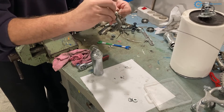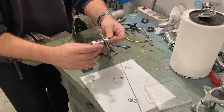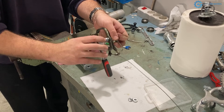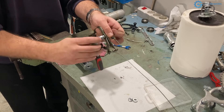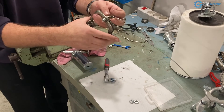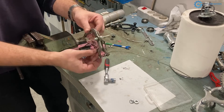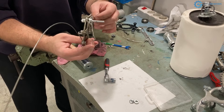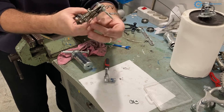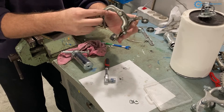On the other side, because the spring-holding section is fixed onto this nut and screw, I don't have to use any lock nuts on that side. Otherwise I would first put lock nuts on the other side, roughly estimate how much protrusion I need on the front, lock it up on the back, and then do fine adjustment on the front. Here I'm making sure only to use the socket wrench to screw in the lock nut with the plastic insert — not to turn the first screw. I could engage the spring right away, and here I'm showing how: just put it on one side and hook it.